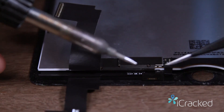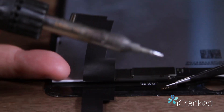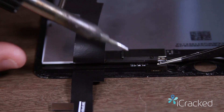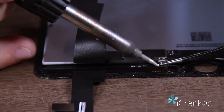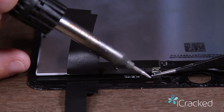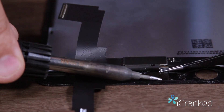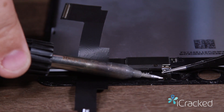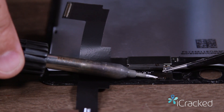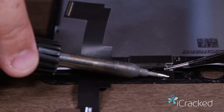Then I'm going to come through and grab it. Now when you solder this, you're not really soldering it — you're not desoldering it. All you're doing is getting it hot enough for the solder to turn liquid and then pull this off. So it's literally just a couple of seconds. Sometimes you have to add solder to it to get it loosened up. You see, I'm just dragging it across.